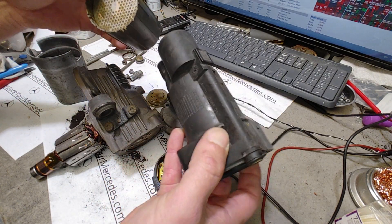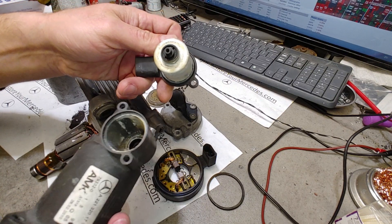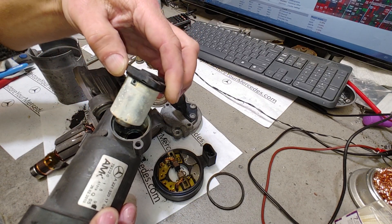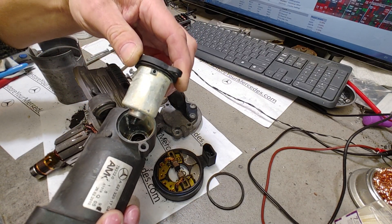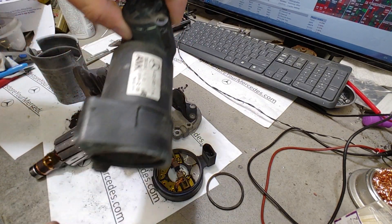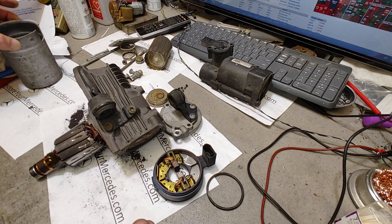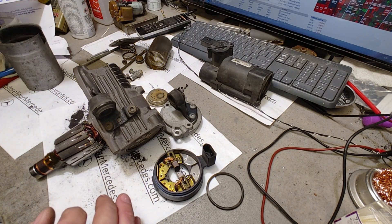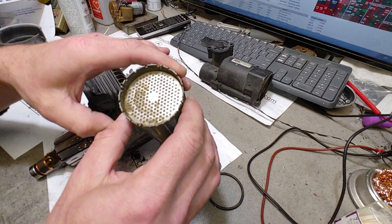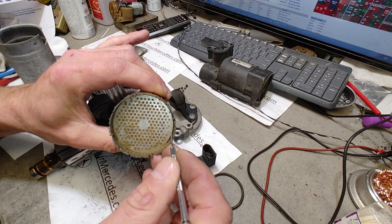The condition on this pump is extremely horrible. It worked until the very end. This is where the moisture filter is supposed to be, and this is the release valve right here. This pump sustained pretty much water damage - moisture entered it and it's really, really terrible. There was also a leak in the strut that appeared, so now the pump just needs to come on for a quick second to pump up pressure in the system.